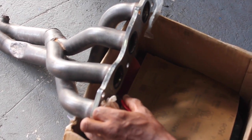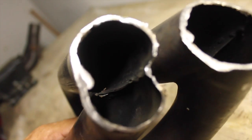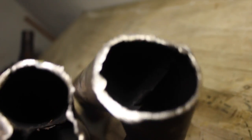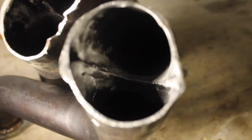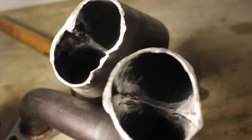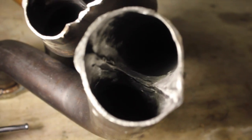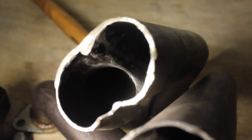So we have nothing here, meaning there's a blockage in the system. Let's take a look inside. It should not have that much lip over here, especially on this one — look at that lip, it's terrible. So if you can see inside there now, it's much more uniform as opposed to what it was previously. That's kind of how you want the inside of your merge collector to be, not one piece overlapping.